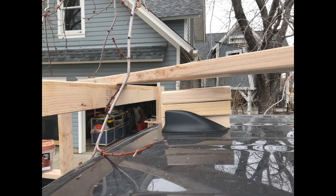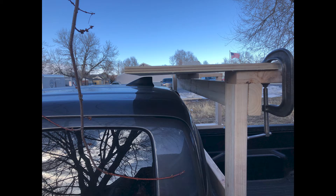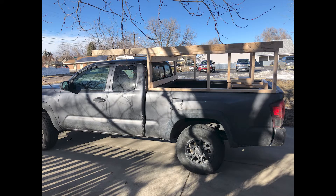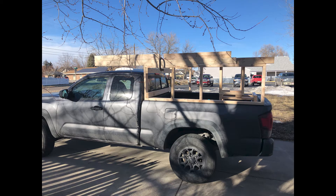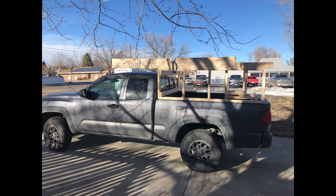Basically what I'm trying to do is measure the distance from the top of that shark fin to the bottom of the 2x4. I took a 2x4 on the rail on the side of the truck and brought it over to the center to get an accurate distance, so I can start cutting those side posts down to get the camper height I need. Once I had those measurements, I took a piece of plywood so you can see how close I am to the top of that shark fin. I also wanted to figure out how far over the cab the camper was going to extend — I think it was around ten to ten-and-a-half feet for the total length, and the camper is just barely over nine feet right now.